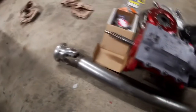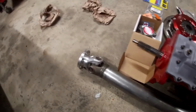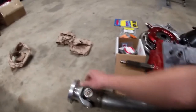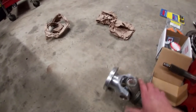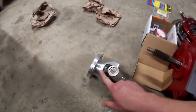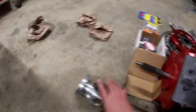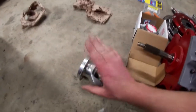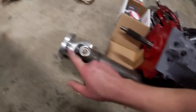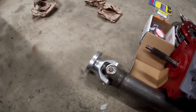You can find those all over the place on NASCAR pages. We're using a Sunex adapter to mount to the rear axle. They have an auto and a manual one, so make sure when you're looking at the Sunex rear yokes you buy the one for your car. This is S550 only — if you have an earlier year you'll need to get the correct yoke for that.